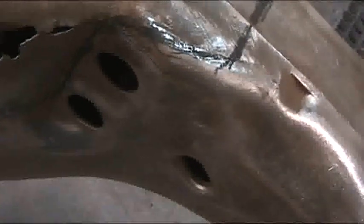That's where the front end bolts on this side. It's good — 90% of it's good — then you've got these spots. I guess that's where all the salt and water and crap laid there and rusted it out. That's what I'm up against here. That's going to be hard getting that in the exact right place, but we'll try. This side's not quite as bad. I'm going to cut that out, take that to work too, see if I can make that piece at work so I've got heat — makes it a lot easier to bend and get those curves right.